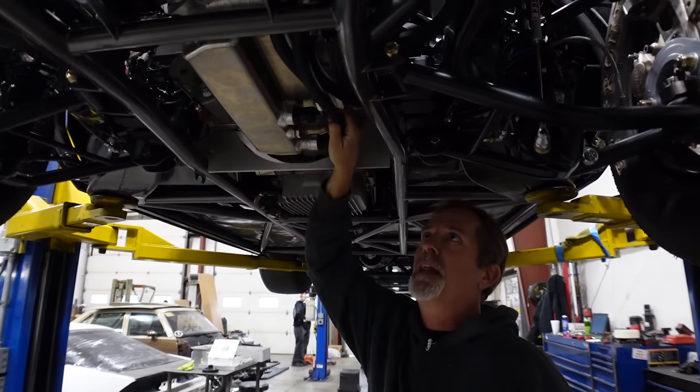It's got a full floating rear end, which might be overkill for a V6 — but you never know. It's got stock-style rear suspension; I could have gone with a traditional four-link, but stock-style suspensions are in my roots — that's what I like. Back here it's got Menser coilovers with cans. Everything's adjustable, double adjustable, with all these different links for the control arms and an anti-roll bar from TRZ. This thing is really badass. The fabrication work that everybody did on this car — they constantly amazed me, always taking it one more step.